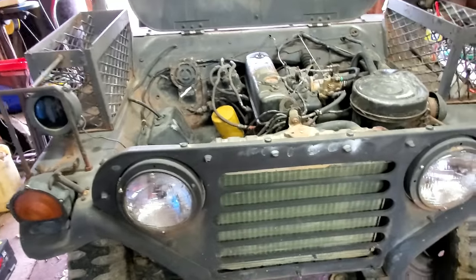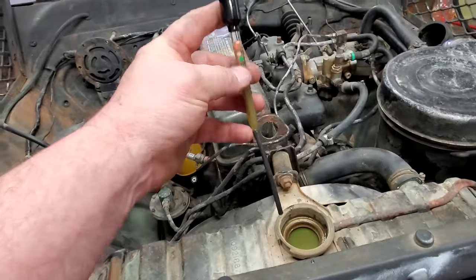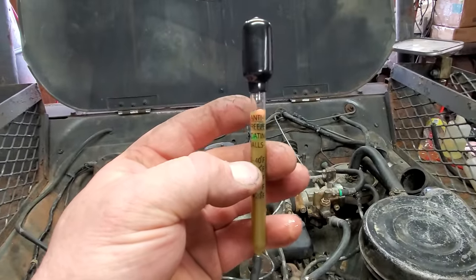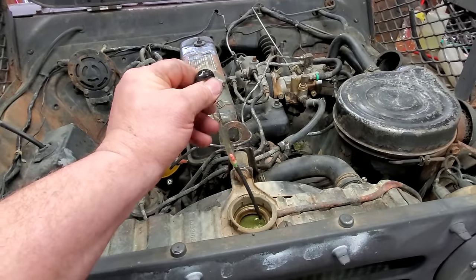That's what they are. Y'all saw me put a straight gallon in the water in this thing, and it is floating all five balls, which means minus 40 protection. It must have had straight antifreeze in it, I reckon.